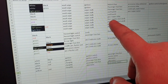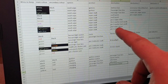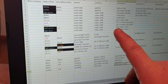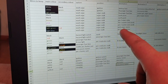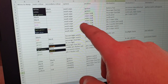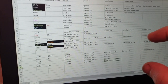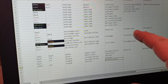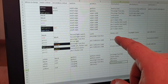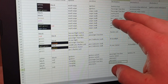Pink is pin one of the washer and green is pin two on the washer bottle — those aren't used because mine are on a separate switch due to an aftermarket washer bottle and pump. Light green and red on the wiper stalk is pin four for the wiper motor, and light blue is pin five. So I can follow all these pins through from the wiper stalk directly to the wiper motor. There is an amplifier bolted onto the wiper motor in the diagram but it has no wire colors listed — these pins go straight to the wiper motor, so as long as I've got these wires it should work perfectly.